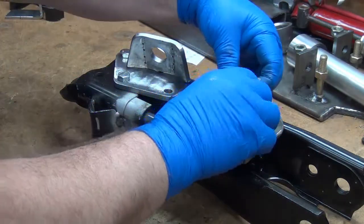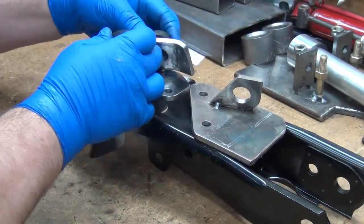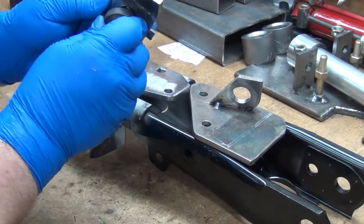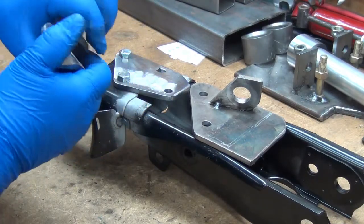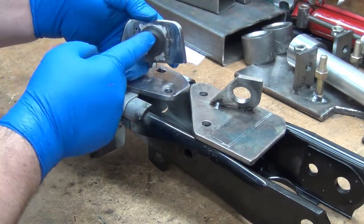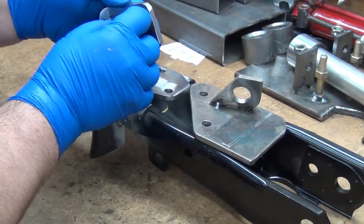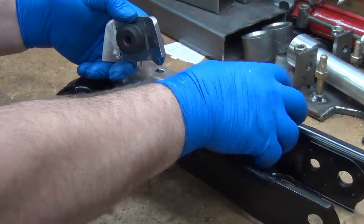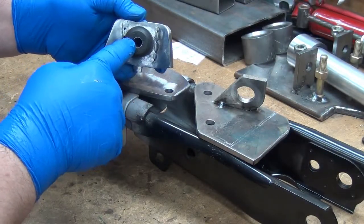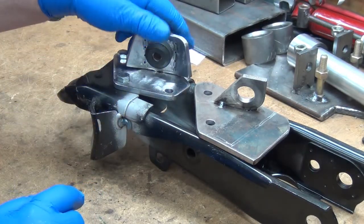But all I had was a 3/8 inch hole in there, and what I want to do is put this in. So I drilled a 13/16 hole in there, and that fits in there, and then this will push in, and then that'll slip over the tension control rod. What that'll do is keep it from eating the tension control rod when the rubber goes bad and starts hitting the edge of the other hole here. That means that sacrificial tube in there will do that. So then you'll start hearing knocking, rattling, whatever, and be able to replace it before it kills the rod itself.